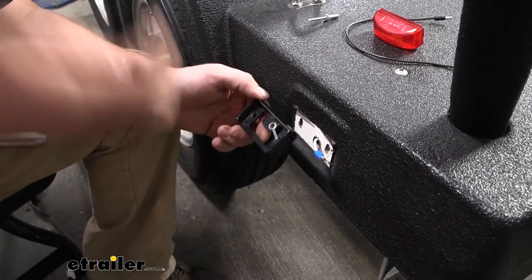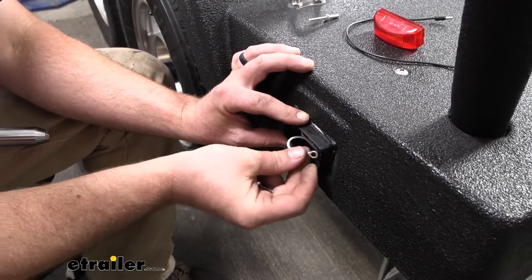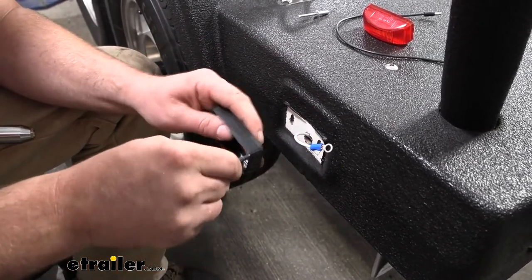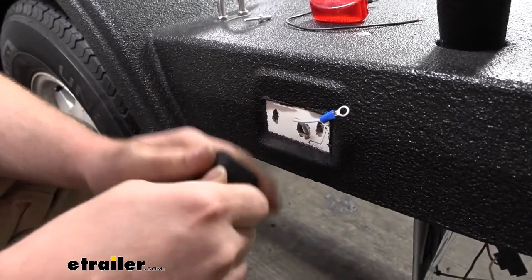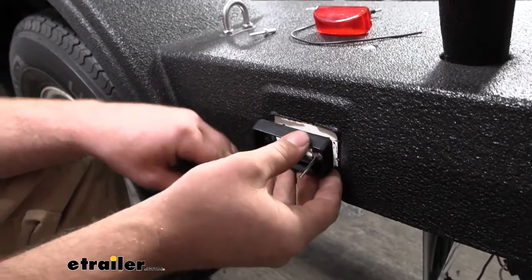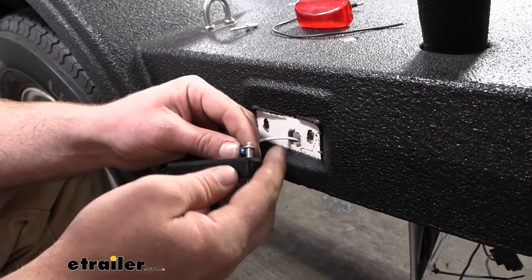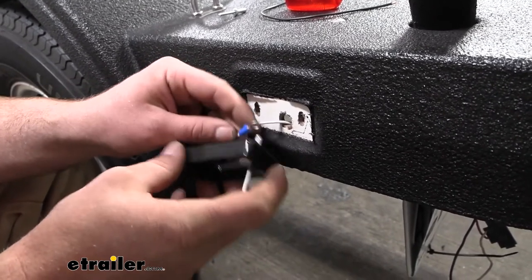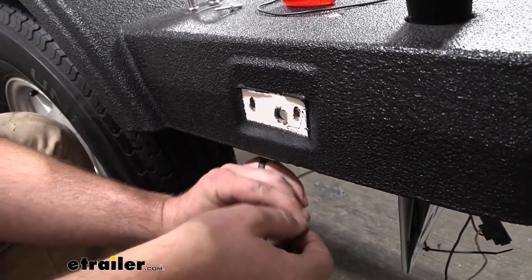Since ours is fiberglass here, we have to do something a little bit different. We actually have a ground wire with a ring terminal on it that is connected to the metal part of our frame. You could either run this through the hole and rivet it there, or since we don't have a lot of room, I'm going to do it on the back side. The rivet will push through the fiberglass and rivet on, and this wire will be on the back side. When you huck this rivet it's going to smash this wire and make it really tight, so the ring terminal will have a good connection to our rivet, which in turn will connect to our grounding post. It's the same difference whether you do it up here or back here — just whatever is easier.